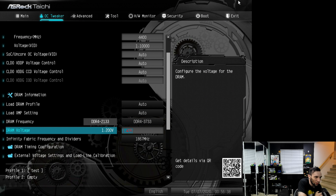So the thing about RAM sticks is they become increasingly unstable the hotter they get. The more voltage you pump into them, the hotter they get. So if you get a really bad case and you are shoving 1.5 volts right off the bat like that, you might run OCCT for about 10 minutes, and then you might get some errors after that because the RAM sticks heated up too much to maintain stability.